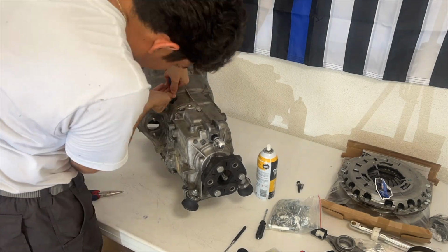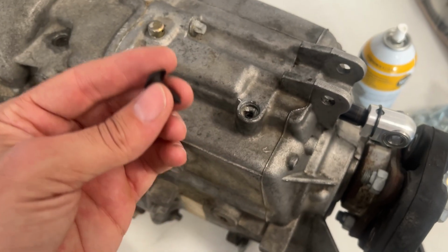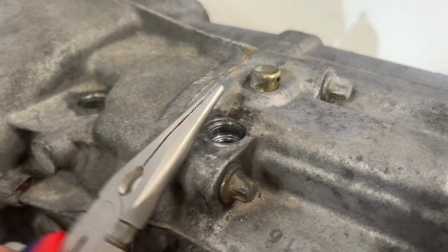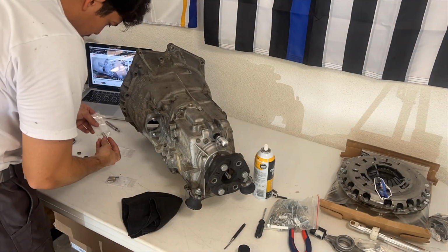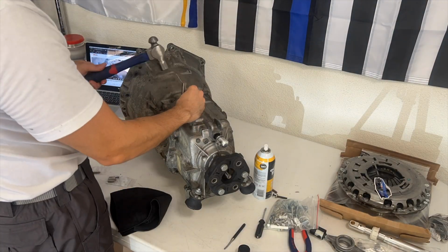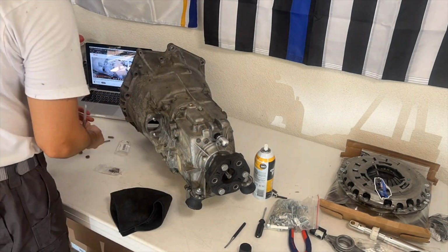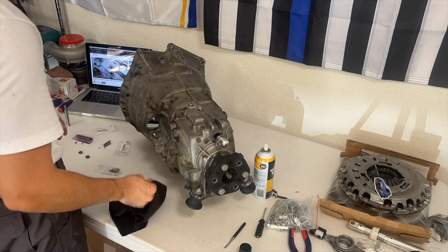Removing the pins for first through fourth requires you to remove the metal caps covering the bores. With a steel cap and an aluminum body, they do not come out easy. Once out, you must reinsert the new sleeves at a specific depth. Too deep and you run the risk of pushing them into the transmission. Just be ready to buy another one at that point. Too shallow and they don't operate the gears properly. But that's what the BMW Drift Kit is for.